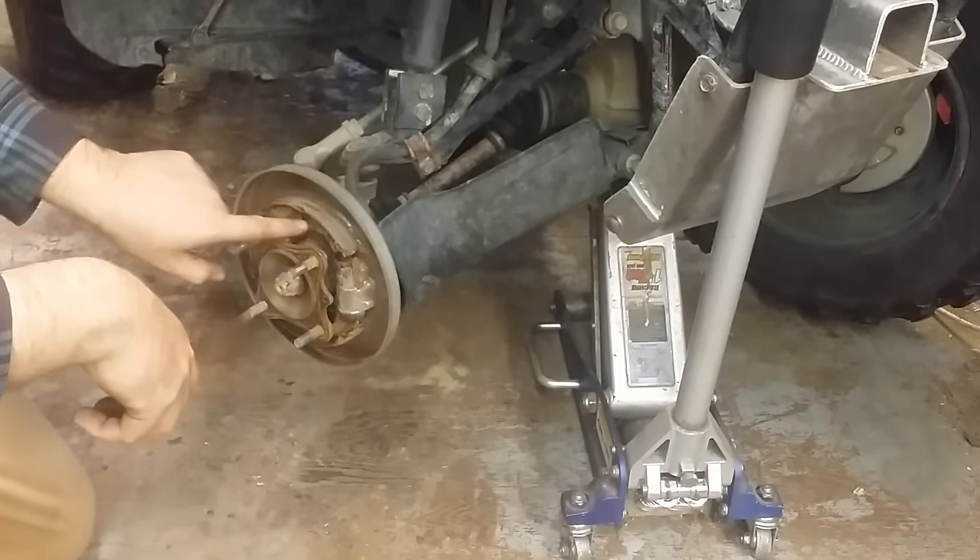This one happens to have all-time four-wheel drive on this specific model, and because it's lifted, they had a spool put in on the front which locks the front axles together, so they don't spin independently anymore. Had I had the parts, I would change this seal on the drum and replace the brake pads. To change the pads: the brake pad literally just pulls out — it's got two little springs behind it, but you can pull it off and the springs will walk around. Same deal for putting it back in.